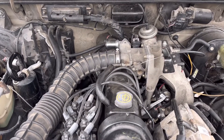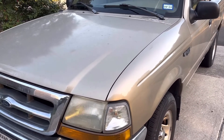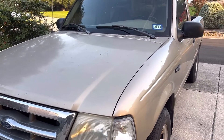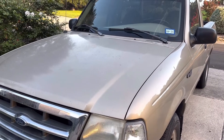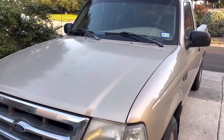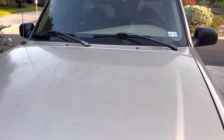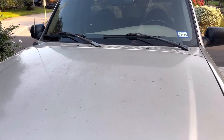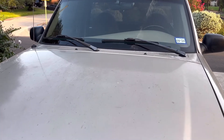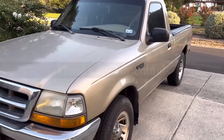In the end, that didn't fix the truck's AC going in and out. But at least you were able to see how to take off your high and low pressure switches and not be afraid to do it — because most if not all of them have a Schrader valve inside. I also noticed that whenever I unplug the idle air control valve it makes this problem worse, so I'm wondering if there's a connection between the idle air control valve and this surging AC compressor, or if I have a broken wire somewhere. Until next time — I'll see you on 'I Just Fix It Myself.'